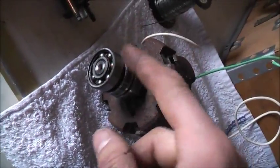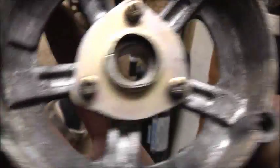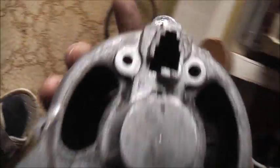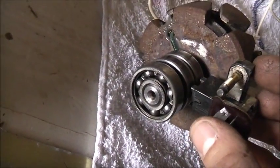Got a little bit of a clean out, put some silicone spray in there. It never had seals on it for some reason — actually it's got a felt pad to keep it lubricated, so I've really lubricated that. The wire comes out those three holes. I've just got to find a way to secure the brushes, because now that the regulator isn't there it's not fitting straight. I think there's still good contact — this was still working. I'll try and see if I can find a set of brushes. They're just touching, but not much though — it may still work.